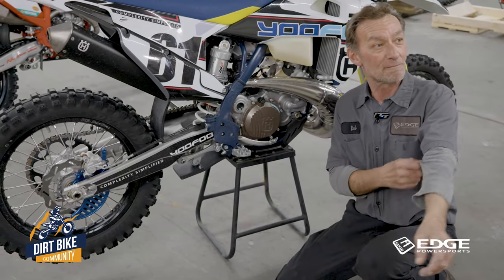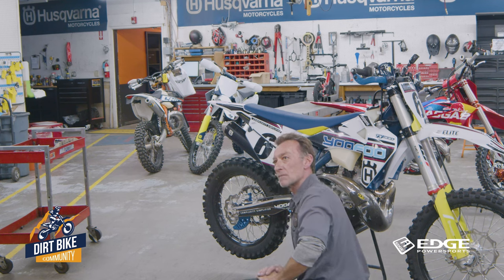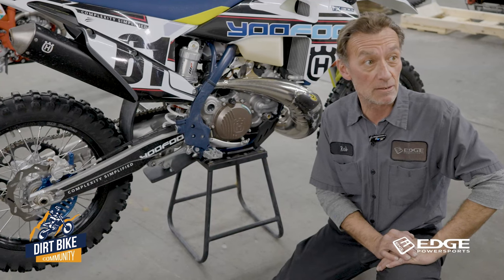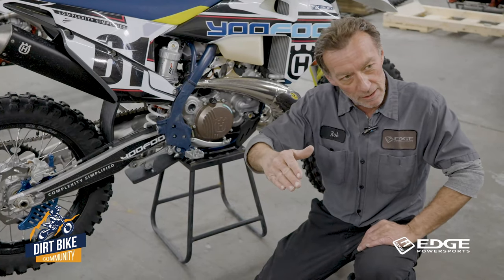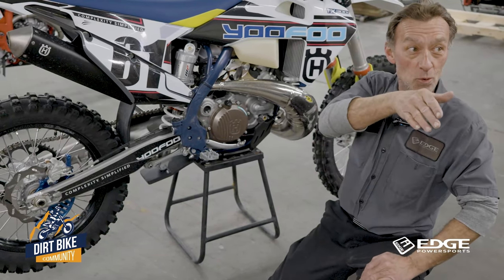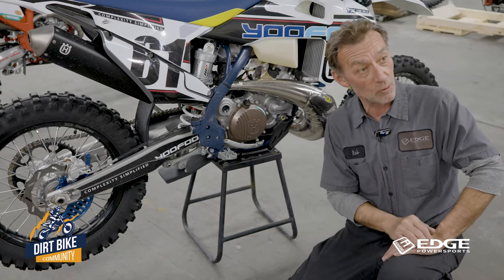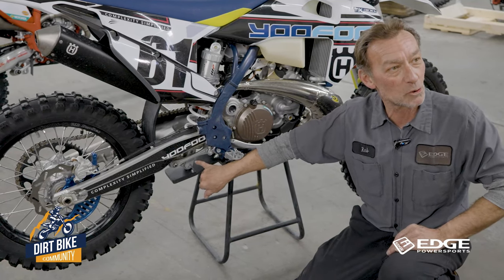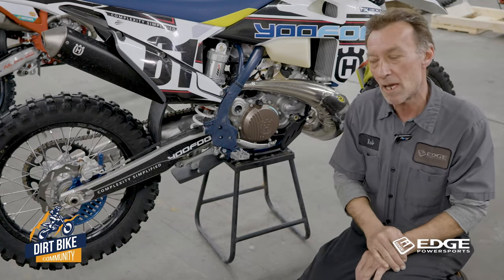Question: when you're riding over bumps and small whoops and you feel like your rear wheel is just whopping all over the place — what does that indicate? Usually that's your rebound moving too fast. Instead of compressing and setting, it's deflecting out — kind of like a fishtail. So if you can slow that rebound down by closing that faucet off a little bit, turning it in, that's going to stabilize things quite a bit.